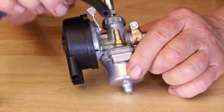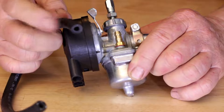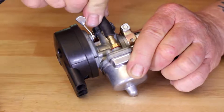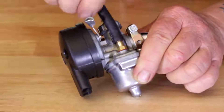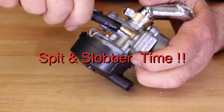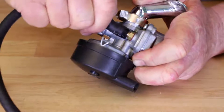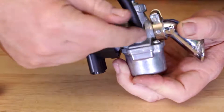Quarter inch is close but quite often the quarter inch is too fat to go on there, so 3/16 is what you want. You've got to work it on — even get it wet a little bit. You want to make sure that you get this fuel line pushed all the way down. And there you go, that fuel line is pushed all the way down.